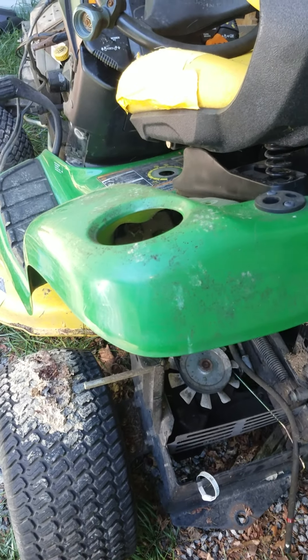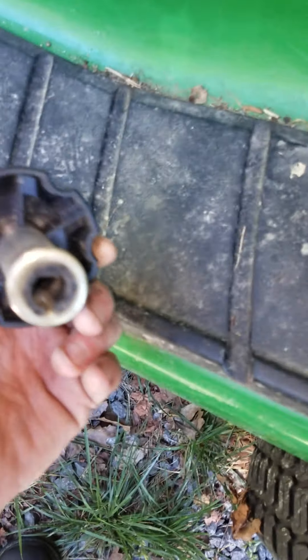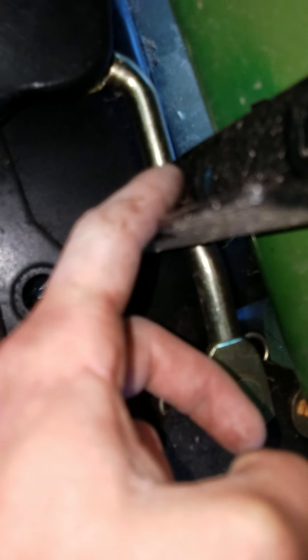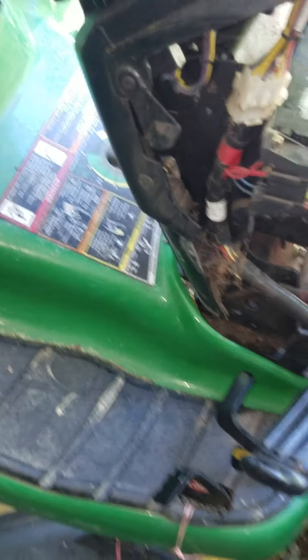After looking more closely, I took the whole fender assembly and seat assembly off — it's pretty simple. The deck adjustment just pops straight up out of it. Then there's a bolt right here that goes down through the foot rail, same on the other side, then one bolt in the beauty panel fender piece, and one bolt here and one bolt here on the fender.